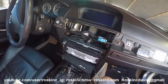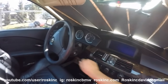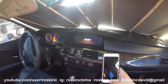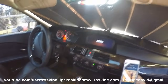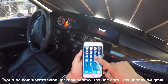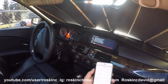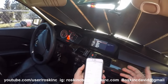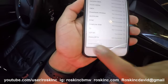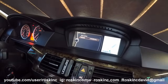Just put everything back together and I'm going to show you guys how to connect it and it working. Now that we got it installed, we're going to go ahead and pair this to the Bluetooth device. You'll hear it say paired when it connects. I have it already pre-paired, but like any phone, you just go to your settings, then go to Bluetooth and you'll find it. This one is called Yet M1. If it comes with a different name, I'll write it in the instructions — the passcode is always going to be 0-0-0. As you can see, it's already connected. Once it's connected, you just go to your regular aux menu on your iDrive and you're ready to go.